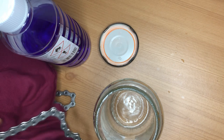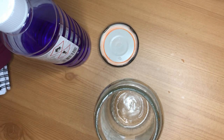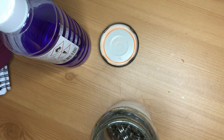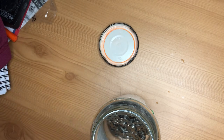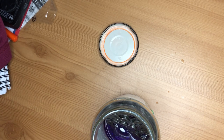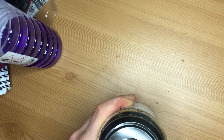All right, so it's round two with the chain. Make sure it's pretty dry - you want to try and get everything off. You won't really see much in the actual liquid, but it's going to be residue on the chain. So you need to make sure on this one that you actually do a good job of getting all of the solvent off. Then it should all be good to go for round two. You don't need a crazy amount of liquid because we're shaking it, so it should get all around. Shake it for two minutes or so, and then we'll need to do a bit of hair drying.